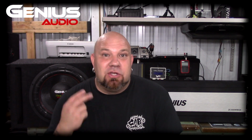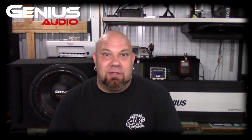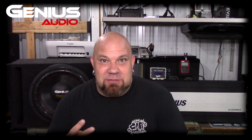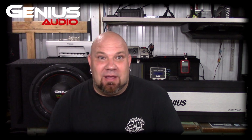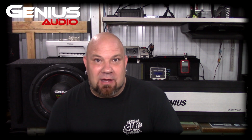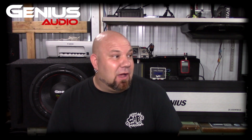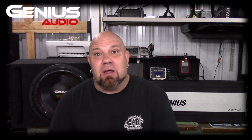Also, it requires 2 0-gauge ground inputs and 2 0-gauge power inputs. It is insane how much power this thing draws, so you are definitely gonna have to beef up all your wiring to handle it. It does run master slave if you have 2 of them. Other than that, it's just a giant powerhouse.